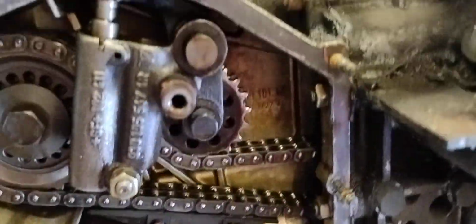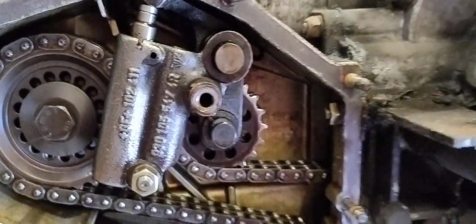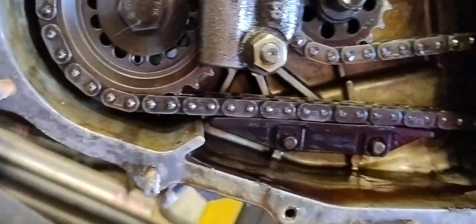come off. Look how far that chain tensioner is extended, and look at the idler arm. It's right on the roof of the chain box. These are the original chains, you can tell by the style. So that one wasn't long to go. Right hand side's not quite as extended, and for whatever reason this one wasn't glued on.